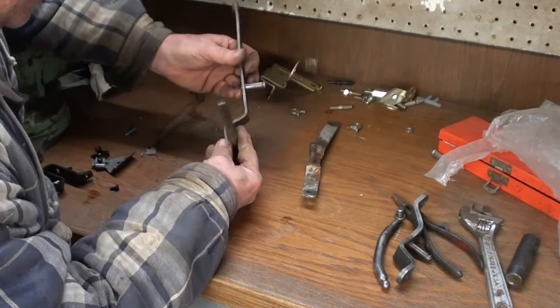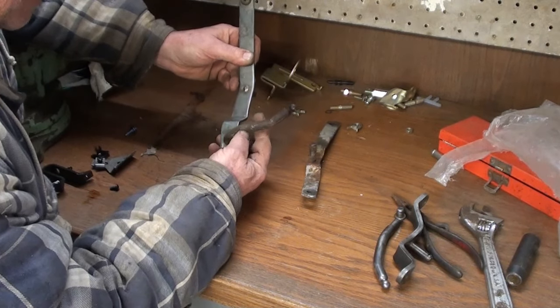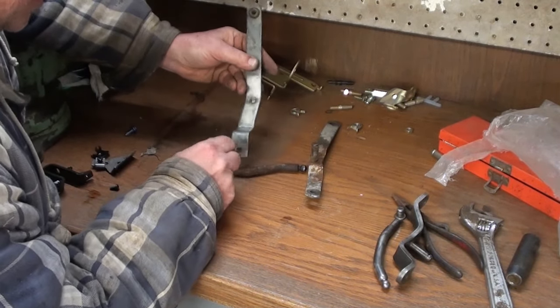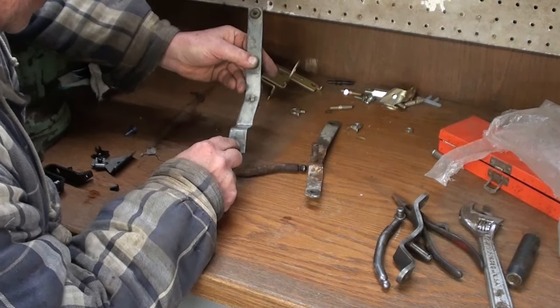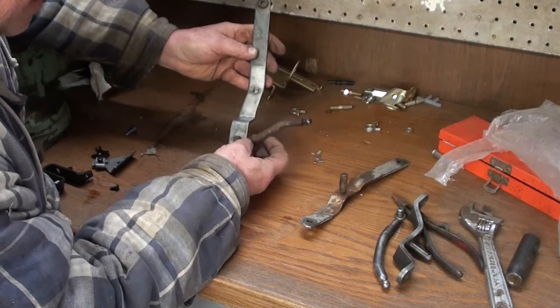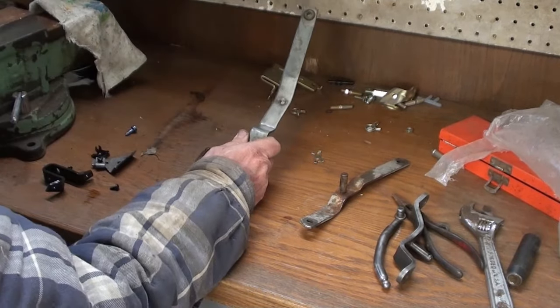You can't turn this around because it's actually going this way — it's this way in the truck, but then you can't see it. So this way fits side to side in the hole, but it binds top and bottom because it wants to be bent this direction. It doesn't bind in the bottom and it doesn't bind in the top, but it's way over too far. This bend here is too low. If you try to put it this way, it's too low. So if I bend this up, that means that'll be sticking out — bend that down, that'd be a 90 there and a 90 there. That will raise this half, five-eighths of an inch, which would be fine. And then if this were put in that way, it would clear at the bottom because it'd be five-eighths up, but then it would bind up here when you go to push the throttle because now it's five-eighths too high. Oh, geometry!